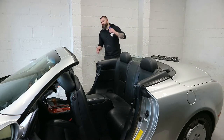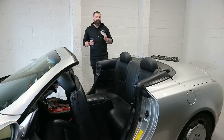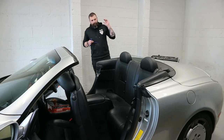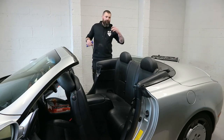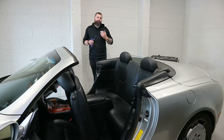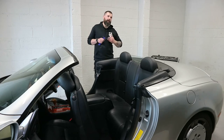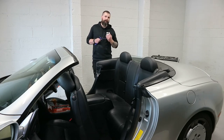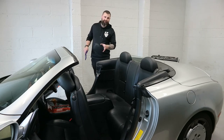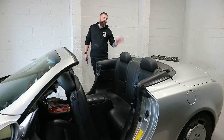So we're going to whip that one out and replace it with another 8 inch subwoofer. I've elected to go for a rather nice Alpine subwoofer. It's much higher rated than the speaker currently in it. It draws a bit more current from the amplifier, so the temperatures inside the amp might increase a little, especially when paired with the uprated 6x9s in the front.